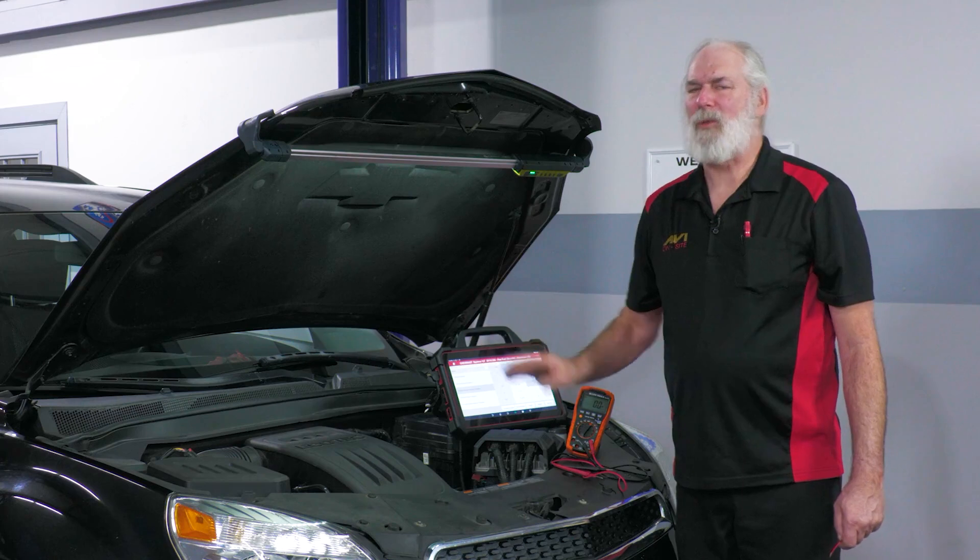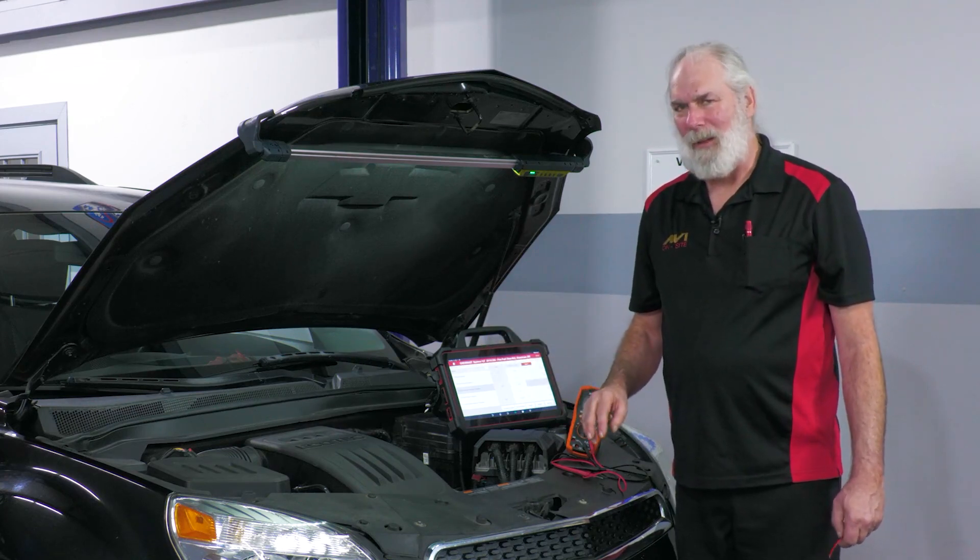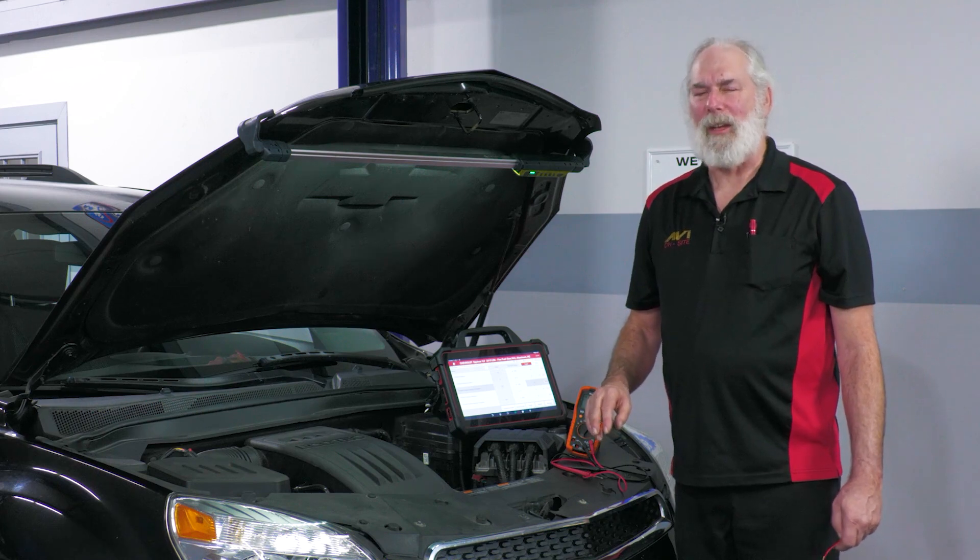So I just confirmed all three wires on a three-wire sensor simply by unplugging it at the sensor, instead of having to check resistance to ground, resistance across the wires, or any additional test. It's a nice fast way to diagnose two-wire and three-wire sensors. This has been a tech tip. I'm Larry Cordell with AVI. Thank you for watching.